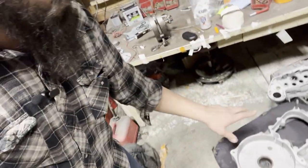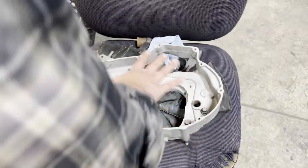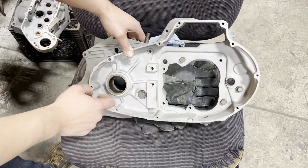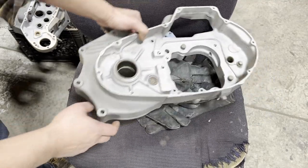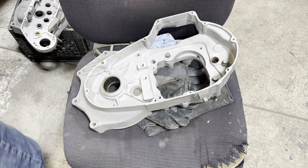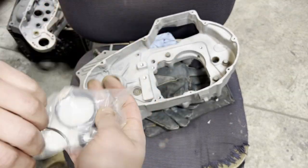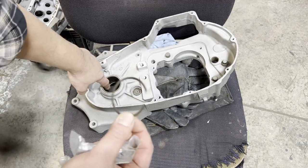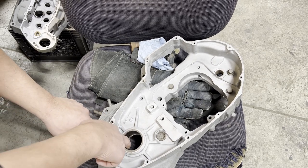I'm going to turn you guys around and do a quick look at the case on the primary side and show you what we're doing on the sprocket shaft for the crank. Here is the left side, primary side of the case — you have the metal sleeve in here that the race will go into. What I needed, and why this took so long, is I need to press these snap rings back in. I open up the package — you can use the old ones if they're in good shape, mine were not. Here's the sprocket kit; it comes with two snap rings. These little snap rings are what bottoms the race out on the inside of the case.